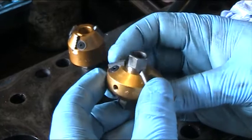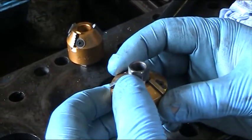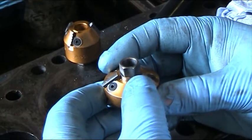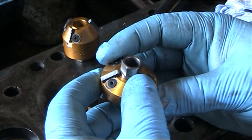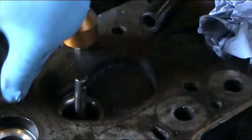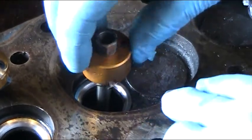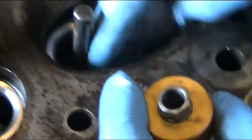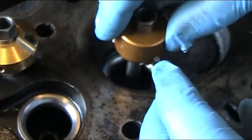We consider these as a nice rough cut — they go in and do a nice rough cut, and then you can finish up with grinding paste, or we have the Quickway here, which gives a nice finish with the grinding stones. So what we do is pop it in like this, and this is going down to do the throat area, which is this area inside here, and widen it out slightly for better flow.